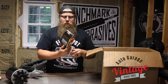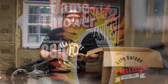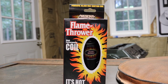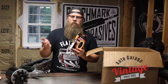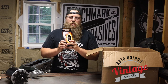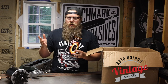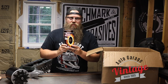Here we have a coil. It's really important what type of coil you get. The coils for a Petronix type setup and the coils for points are actually different — they have different ohm ratings. What I have here is a coil for Petronix. If you get it for Petronix, it can also do points. If you get it for points, it cannot do Petronix — technically your car would start but it wouldn't be getting all the juice it actually can have. So I like to just get the Petronix one. I'm running points right now, but later on if I want to switch over to Petronix, I have nothing to worry about — this is ready to go.